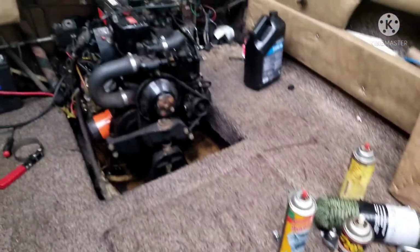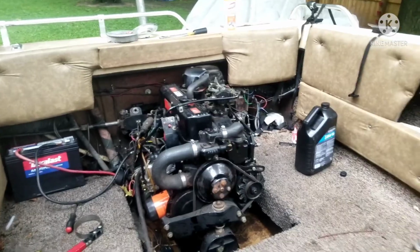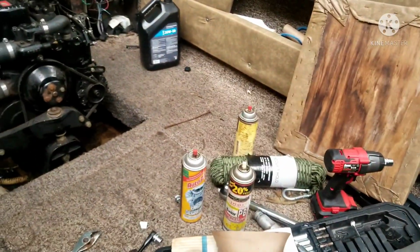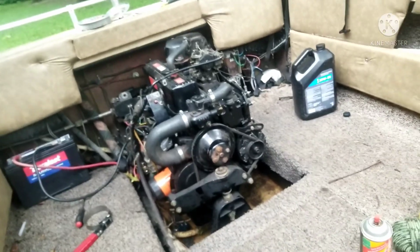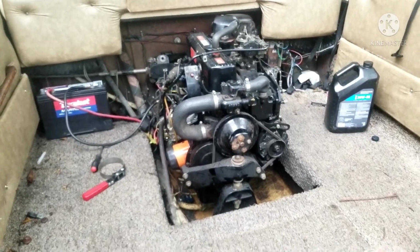Huh. Yeah, I almost got it to fire up. Maybe the valve timing is off. I tried cranking this for a while and no luck. It might be the valves, like I said. With my mini bike motor, I ran into a similar mistake where I didn't lash the valves correctly. So I'm gonna disconnect the battery and relash the valves the next day.